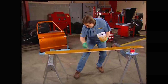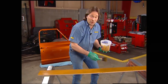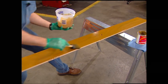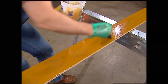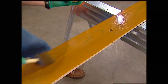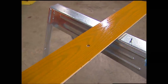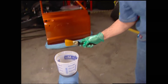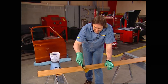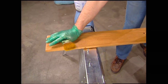Welcome back. We are in the process of showing you how to put a nice quality finish on the wood bed in your truck, using products from Bruce Horky's Wood and Parts. We've got the wood all sanded down nice and smooth, and now it is time for the finish — the first step is the stain. We're going to put this on using nice long strokes, making sure it stays uniform. This product will seal the wood and stain it a nice golden oak color. Once your stain is dry, you're ready to move on to your varnish. Make sure that you do all of the wood — not just the top. You need to do the sides, the bottom, the ends, everything. Because if you don't, that's where moisture will get in, and that will cause your wood to split and crack.